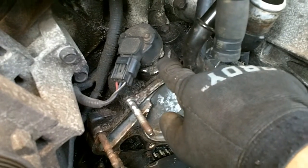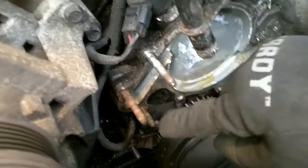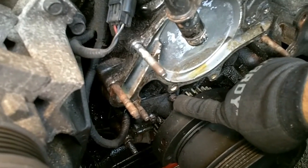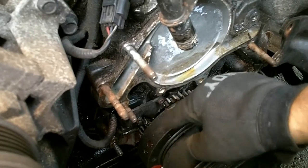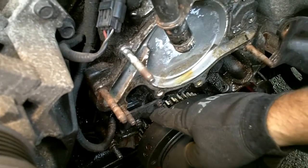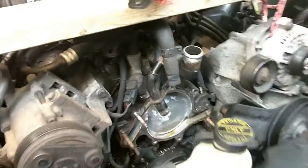Okay, we're back at it today. Our next step is to remove the camshaft position sensor. I think this is that 10 millimeter bolt right there. And then down lower, the crankshaft position sensor. These look like 8 millimeter bolts, and strangely they kind of look loose already. Maybe that's just the cover. We'll find out.